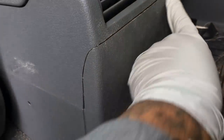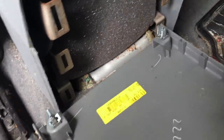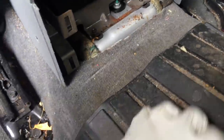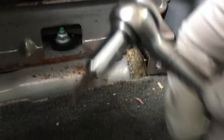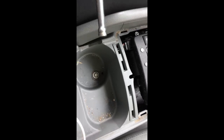On the driver side, put the seat all the way forward — there's one more screw there. Next, where you have your air ducts for the back seat, there's a panel. Take a flat blade screwdriver, put it between the panel and the seam, and pry it out — it's held in by four clips. Once you have that out, you have access to two more Torx head screws — those are T20s. Take both out and don't lose them.